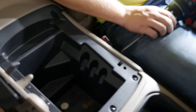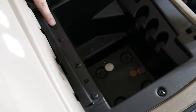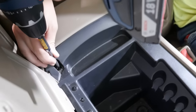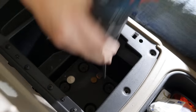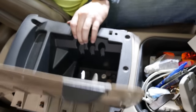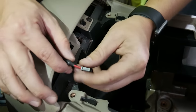Now remove the inside of the center console. There are screws here, here, and here. You do not need to remove the four screws for the lid — leave those on. Once all the other screws are out, the center console insert will just lift out. Bring it forward just a little bit — you don't have to take it all the way out. Take the end with the two wires and pass it through, grabbing it on the other side.